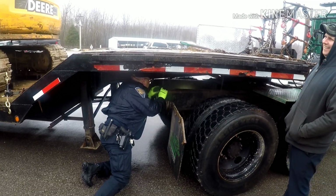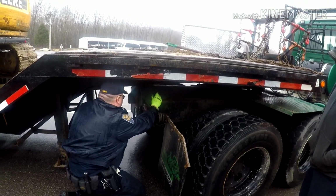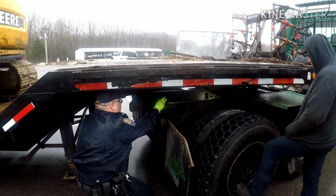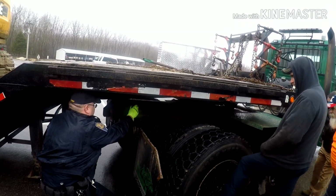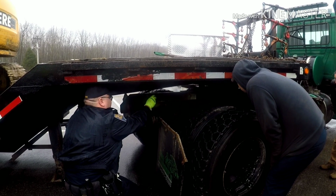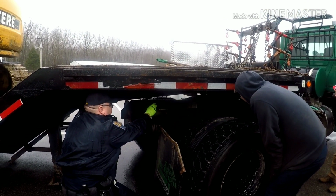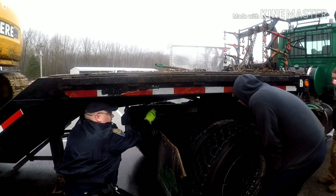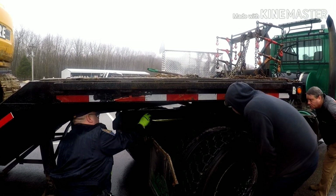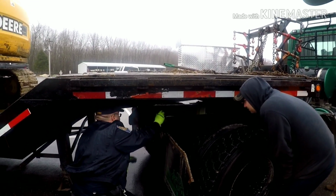So with a flashlight, like I said, getting yourself a good flashlight, you can do a lot. Just by, real simple, I'm following this airline down to the brake chamber. An area that I would look at if I was really getting into this is see how that airline's kind of resting on that frame. That would be an area that I could pull up and probably find some rubbing or chafing. I can tell it's rubbed in there now. Oh yeah, it's probably out of service. I should just put it out right now.